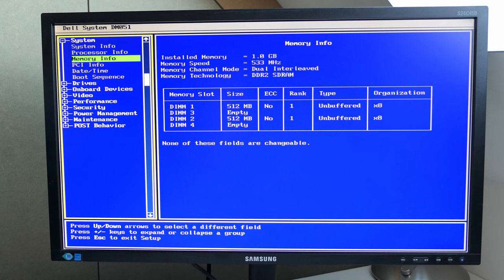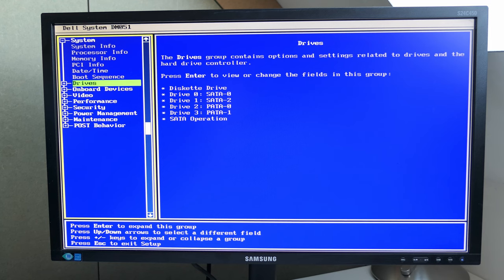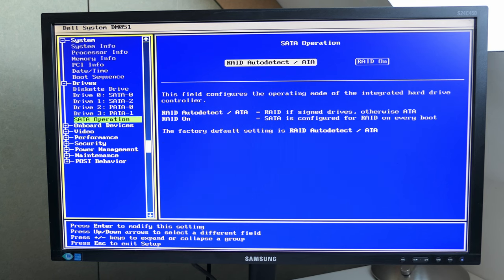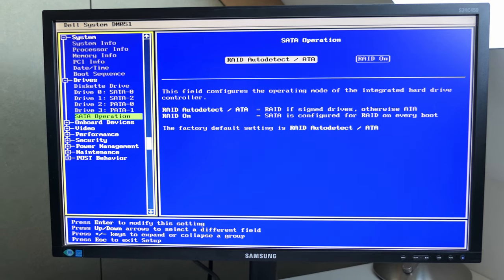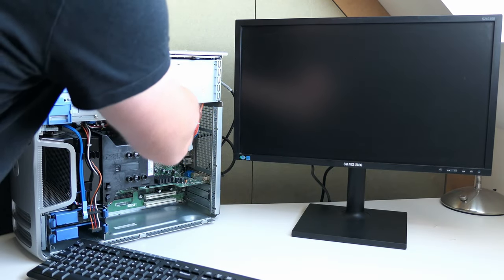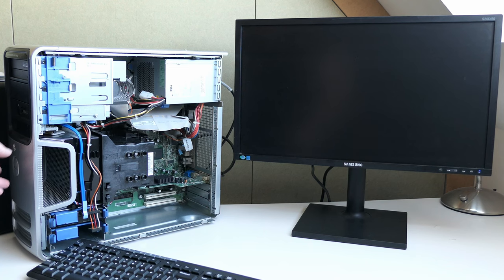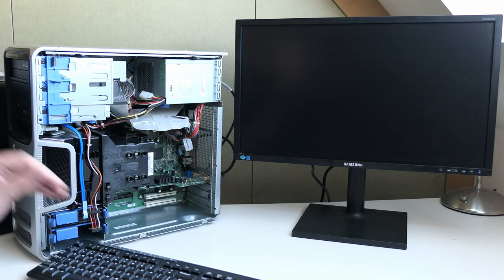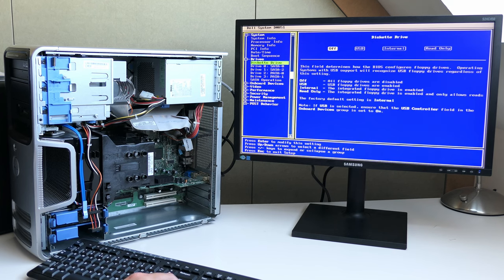The memory here is DDR2, for a total of 1 GB with two modules installed. No drives are detected — neither SATA, where you would expect to see the hard drive, nor PATA for the DVD drive. For the DVD drive, the fix was not too hard: the drive is configured with the jumper as cable select, and since I connected it to the second connector without the master it couldn't be detected. Simply changing it to the first connector, we are able to see the drive now.